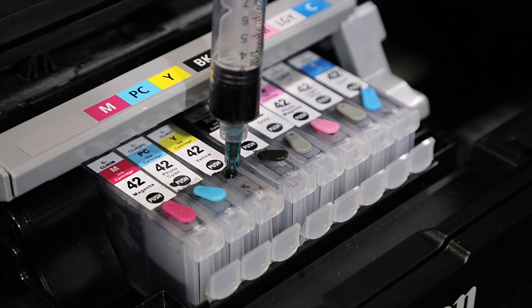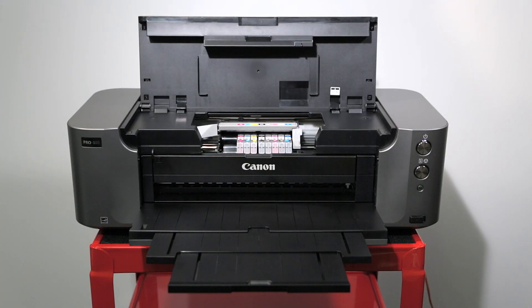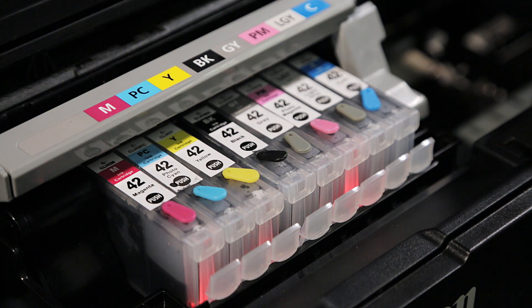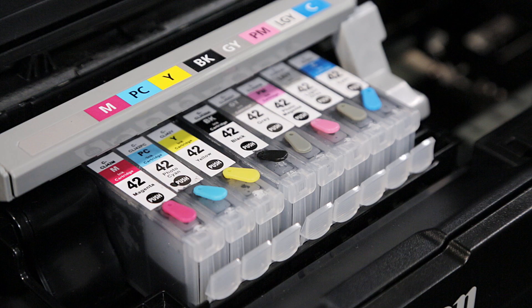Here's how to refill cartridges while still installed in the printer. Open the printer to reveal the printhead and ink cartridges. You may notice that some slots are flashing red lights, others may display a steady red light, while others may have no light on at all. There's no need to worry about this — the printer is simply trying to tell you that the cartridge chips will soon report as expired or have already expired. This can be ignored at this time. With the printhead in the centered maintenance position, remove the power cord from the back of the printer to ensure that the printhead does not return to its inaccessible standby position while you are refilling. Without pulling the power cable, you have 10 minutes to complete the task.